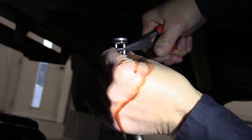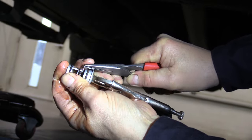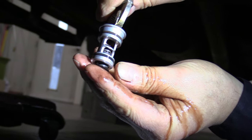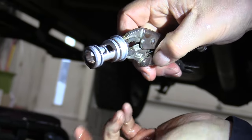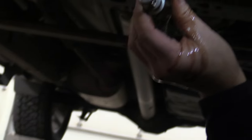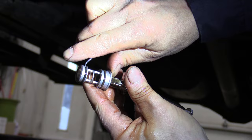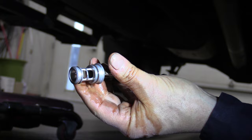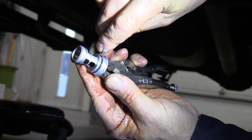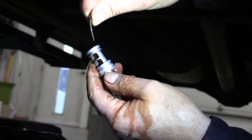There's a spring behind the clip. That gets tossed, along with that spring there and that little rubber piece. Then I've got an O-ring pick — let me take out this O-ring right here. That doesn't get put back — there's a new one to replace this in the kit. This is your main seal for that cap and that one will get replaced.